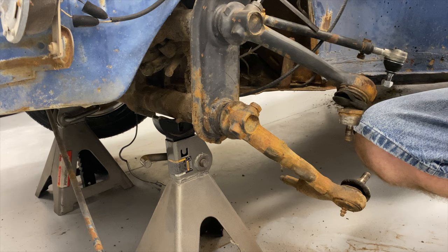I'm going to start cleaning out the interior a little bit because it's dirty and yucky. I actually just noticed we've got a lot of debris under the passenger side rear floor, which means that floor pan had an insert on the inside — that's why it seems kind of solid, but it's actually not. So I'm probably going to have to do a floor pan along with rust repair. That nice little hole on the back of the fender well at the bottom of the A-pillar is very rusted out with no metal left — we'll obviously have to repair that. It's not going to kill the car's road-worthiness, but it's better to do it sooner rather than later.